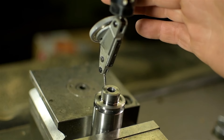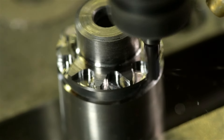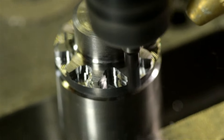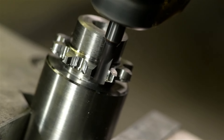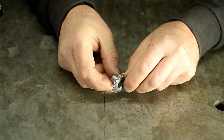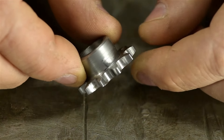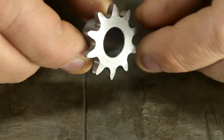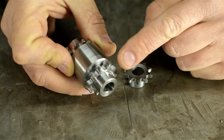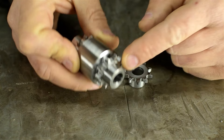I've got an indicator in the spindle, sweeping around the part and adjusting the spindle position until I'm zeroed out. And here's the almost finished part - doesn't look all that bad, does it? Needs a little bit of deburring, a small file, maybe a shot on the wire wheel. Full disclosure though: this was my third try. The first two didn't go so well. Rookie mistake on the first one - I used an end mill that was too close to my finished size, getting too much cutter engagement, and my router can't handle loads like that.